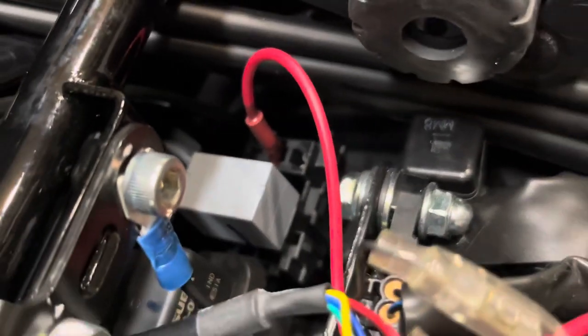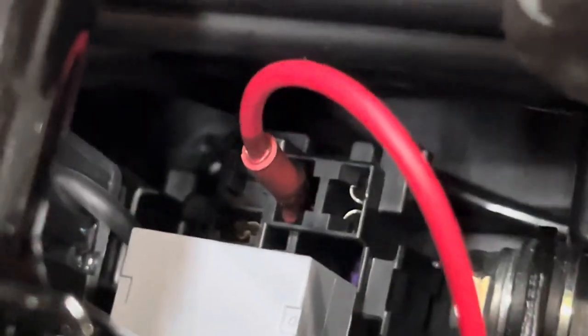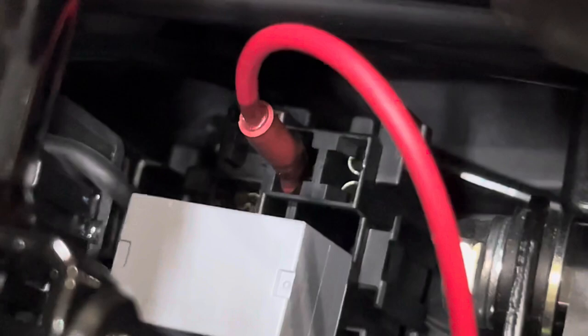On the 2023 model, they did not put a relay back here — they saved 50 cents by not putting that relay in. So the kit for the accessory plug comes with that relay. What I did instead is I checked in the middle — the very middle pin — which is your switched ignition.